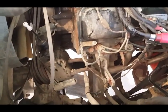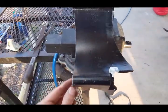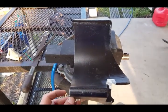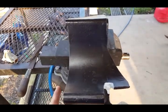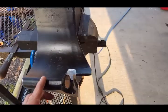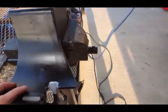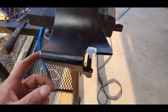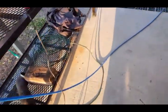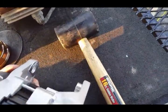I didn't want to take too much off, but I did get it off. I'm going to show you how you can use the original bracket. There was a lip that stuck out, and if I mounted the alternator there the pulley would have been out almost a half inch too far. So I cut that lip off — actually a big piece — and it's aluminum, so it cuts easily. I drilled and tapped this hole, which was solid through here, seven-sixteenths tap, which is the same size bolt.